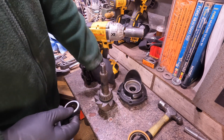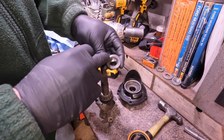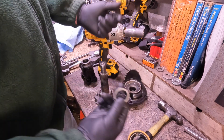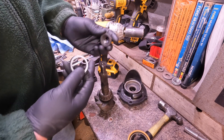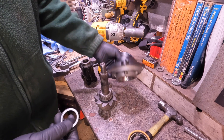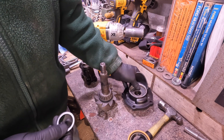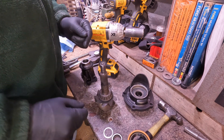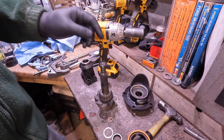When you know what you need, you put the seal in, then put it together one last time with a brand new nut. The new nut will have some kind of thread sealant on it to stop oil from coming through the threads. Then this thing will be set up, done, and ready to be put into the center section.